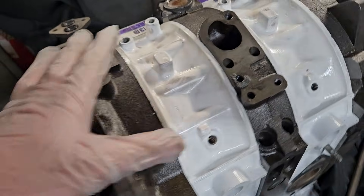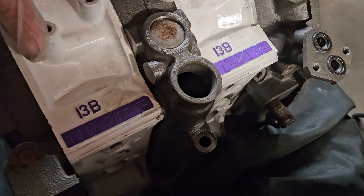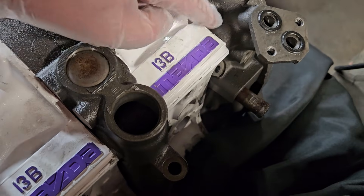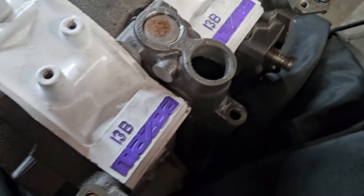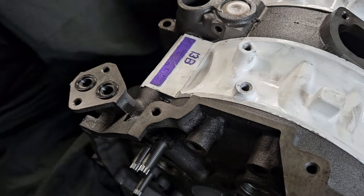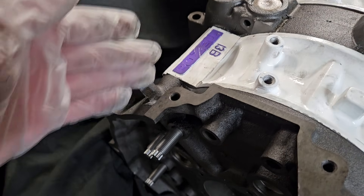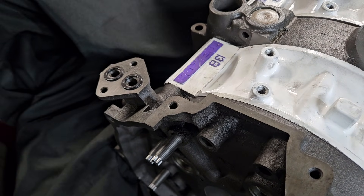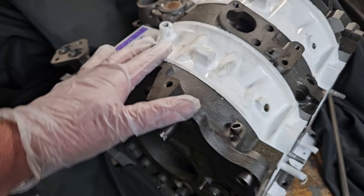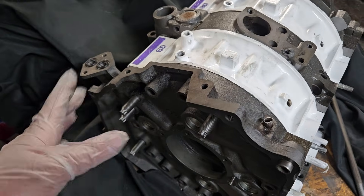The reason is these motors were cast before Mazda started to increase their dowel pin land area size. Here on the front plate and on your rear housing rear plate where your oil gallery runs through the dowel pins, it's actually an exceptionally thin casting. So if you try to apply much boost pressure to these motors, they have a tendency to crack. This can be caused by detonation, twisting, or boost pressure. There's not really any RPM problems with these motors when it comes to fatigue — it's mostly on the power adder side.